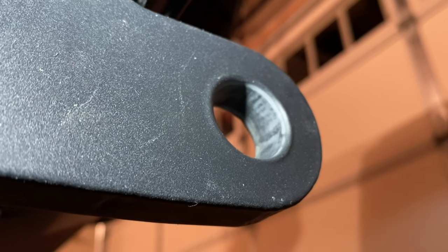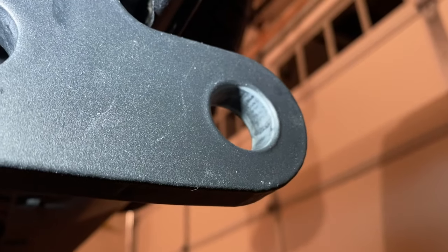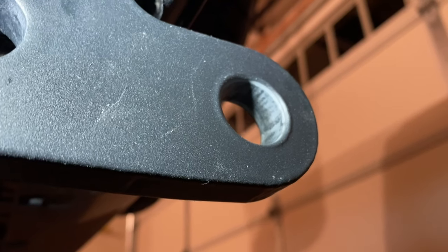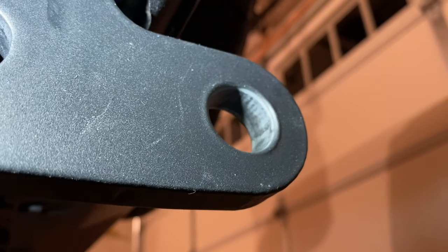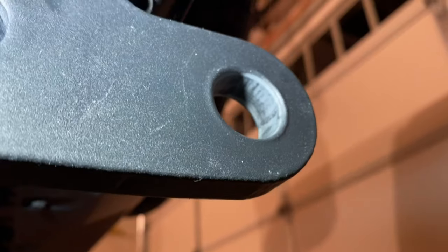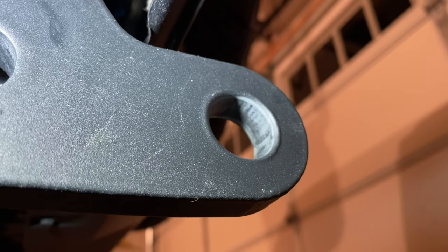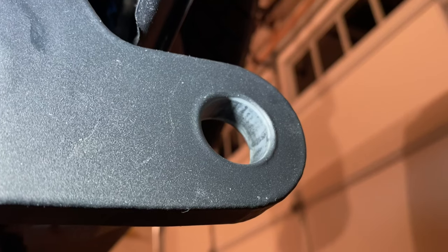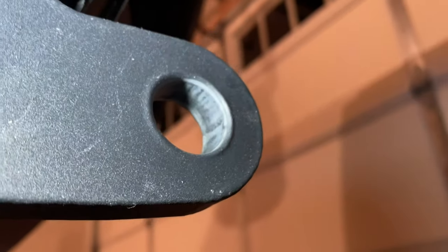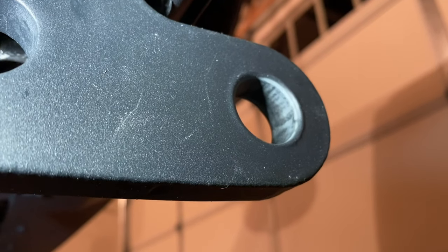I had to take some 600 grit sandpaper — my three-quarter inch pins for my shackles would not slide through there. I rolled up the sandpaper and used an in-and-out motion while rotating it. That was an effective combination and I did that over and over again until I got the pin to slide all the way through freely. One pin I had to sand; the other was fine, it slid right in. I think there was a little excess powder coating on it. Just wanted to give you a heads up, because who wants to be out on the trail beating the pins to get them in and out?